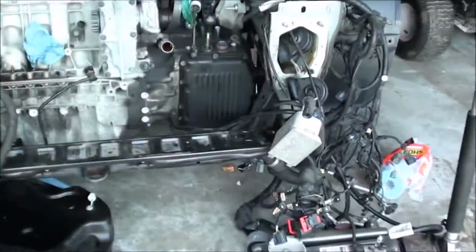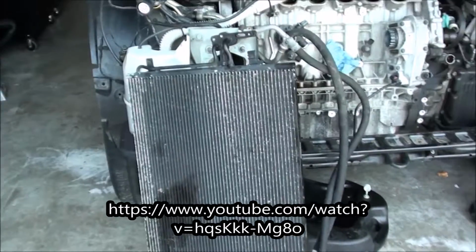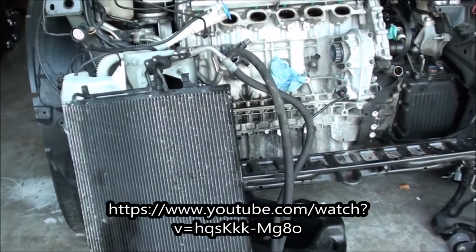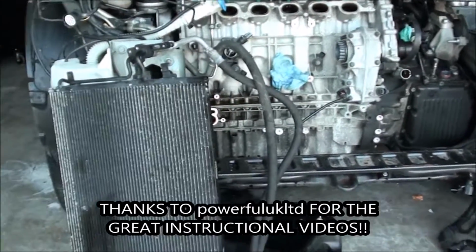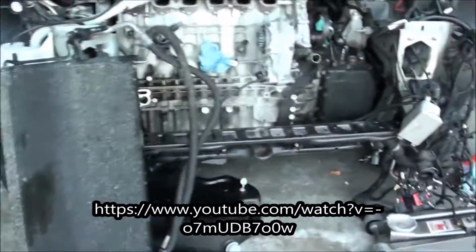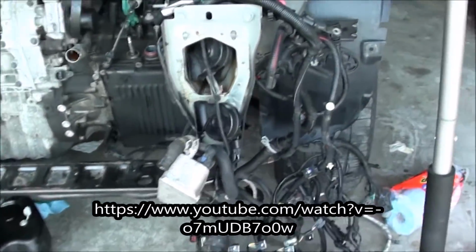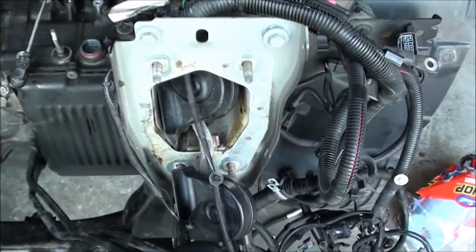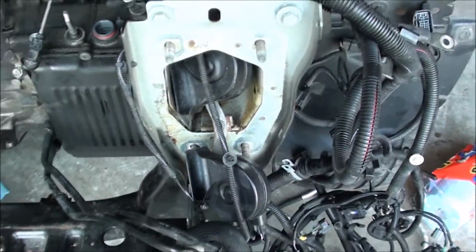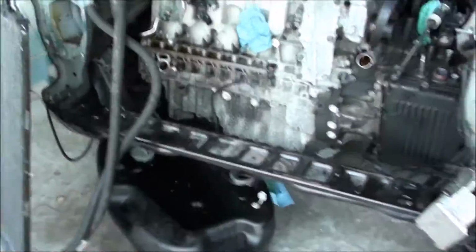Started with the bumper cover. I'll put a link in the description for that. There's a good video out there. I forget whose video it is, but I'll give you a shout out once I figure out who it is. Once you take off that bumper cover, you take off the bumper support that goes across. Fairly simple. I'll put another link in the description from the same YouTube video set, but literally it's just 4 bolts. You take those off and on the other side and just pull that right off.